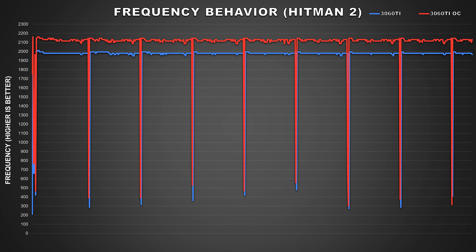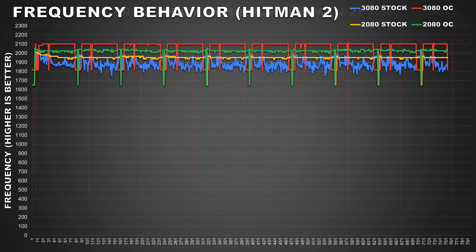When overclocked, we see a drastic change in terms of boost frequency. I was able to manage a 150MHz offset for the core and plus 1000MHz for the memory in MSI Afterburner. With those OC settings applied, the card maintains an average boost frequency of just under 2100MHz at 2092MHz, sustaining around 2130 to 2145MHz — which is excellent. Usually to sustain boost frequencies above 2100MHz, you either need water cooling or get lucky with the silicon lottery, which is what happened here with just air cooling. This boost behavior is consistent with what we've come to expect from Ampere-based cards.